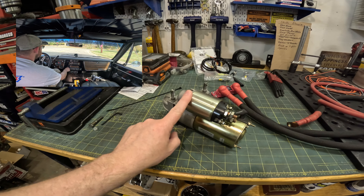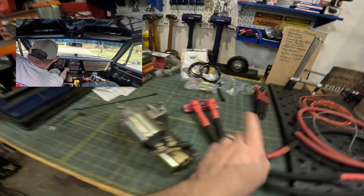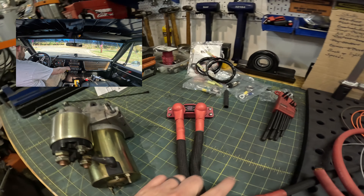Welcome. I'm Gorm of Gormworks. Tonight we're going to address some of the things that went wrong last time when we took this thing for a shakedown drive — the starter that gave up at the gas station because it was heat soaked and blew up a 250 amp AMG fuse. I'll show you what we do to fix that, how we make the temperature gauge move correctly, and some more stuff. Buckle in, let's get to work today.